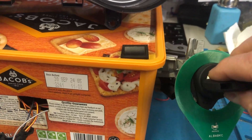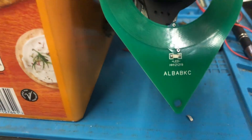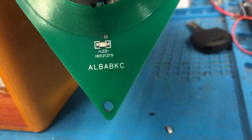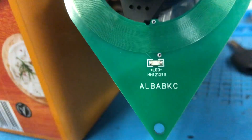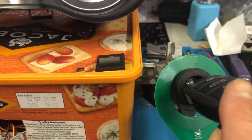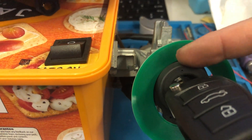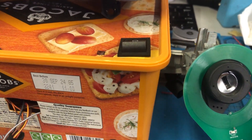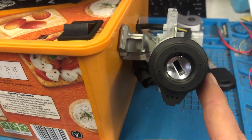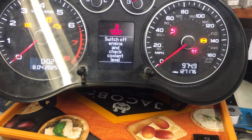Normally that would prevent the car from starting, but we've gotten around that with an immobilizer delete. Now if I do it with the key that the locksmith made — put it in — you can see the LED only blinks very briefly. That very quick blink shows the locksmith's key is actually working fine. This proves that the transceiver coil on the customer's car is not working, because on the cracker box we have a working original transceiver coil and an ignition switch with no wafers in it, so you can use any key, which is handy for programming.